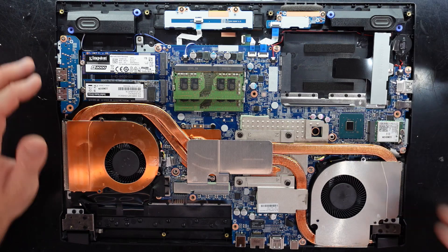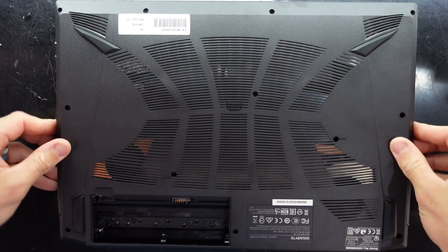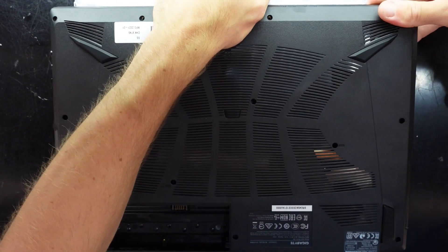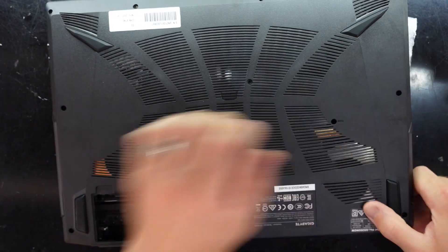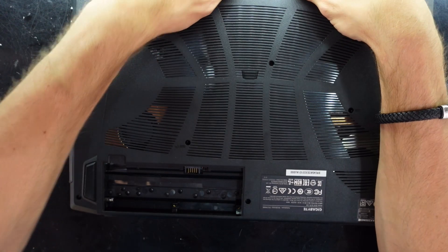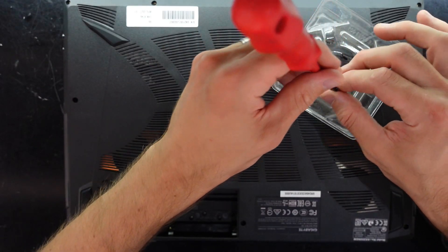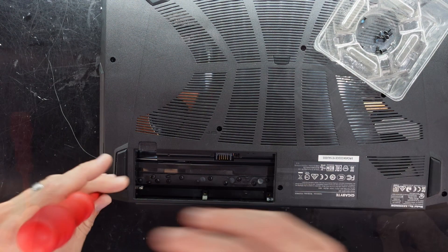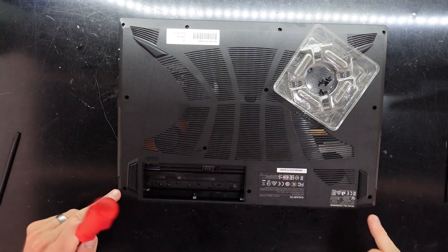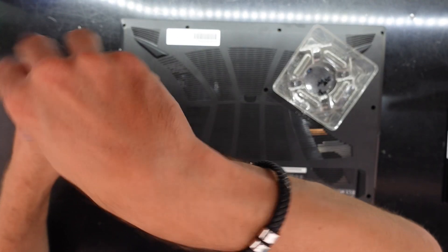Anyway, I'm going to get this back together and start downloading some games to benchmark. I've already tried Doom Eternal and that's looking and playing pretty damn well. The biggest issue though has been the fan noise - it's pretty atrocious, especially going from a thin and light to this. During the initial setup process the amount of fan noise was almost ridiculous. A key tip for reassembly: be cautious about where you put the longer screws, as they go into the hinge. Shorter screws go everywhere else.